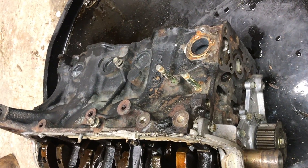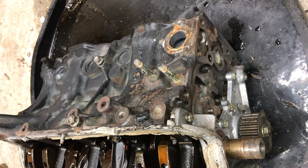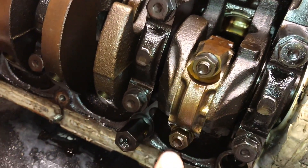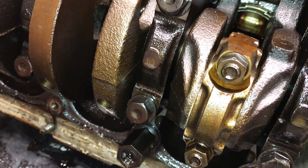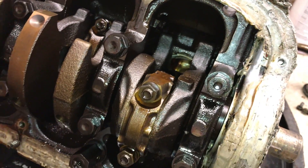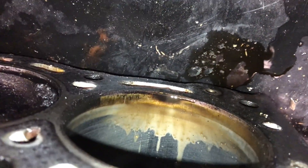So we have removed all the accessories — took off the crank pulley and all its timing belt hardware, removed the alternator and bracket and the water pump housing, and we've taken off the oil pan. Next we just have to remove the pickup and then we can start removing pistons from the block. The idea is to just remove these two nuts, then pull off the cap — it pulls straight out, usually a pretty tight transition fit. Then you can push down on the underside of the piston and it will just slide right out of the block. Sometimes you get a small ridge of carbon on this side and it can be a bit difficult to push the piston through, but usually that's not too bad.